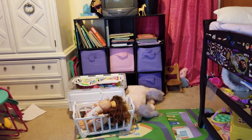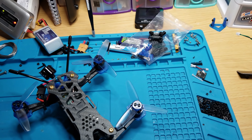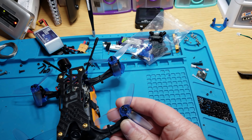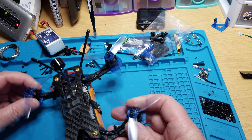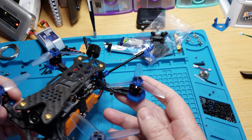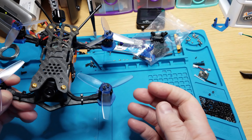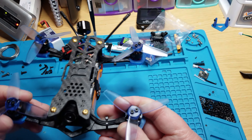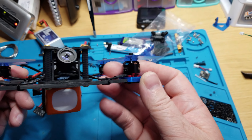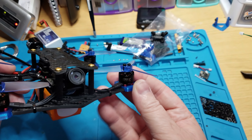I'm really liking these motors. When I first ordered a set, one had a broken wire brand new out of the package. I didn't want to deal with contacting Emax so I just ordered a replacement and put it on — they're all good now. I'm sure it was a fluke; same thing happened with their 1106 motors when they first came out, and I've probably ordered 50 sets since with no bad motors. These are a good price and they scream on 4S, with quite a bit of power on 3S too.